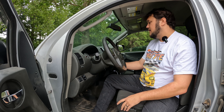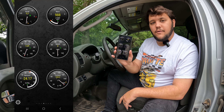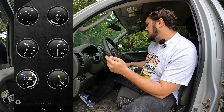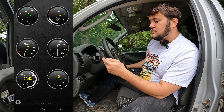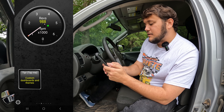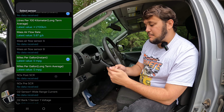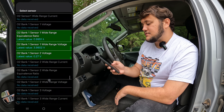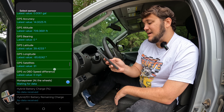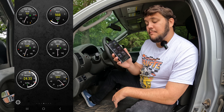Let's test out live data on each item real quick. Starting with live data on the VPeak — we have the Torque app fired up, and I actually see a throttle input and a vacuum. Let's give the throttle just a little blip and see what our vacuum does. Not too bad — and the nice thing is it'll actually tell us the high and low value. You can put in graphs, but my only concern with something like this is you don't always get the data that you really want. For example, I tow 5,200 pounds with my Xterra sometimes and I'd really like to monitor transmission temperature. The Torque app actually has a transmission temperature option, however it's not reading any real sensor data — it's a calculated thing. So while this does work, it's really only going to log the basic sensors; anything beyond that you're probably not going to be able to get.